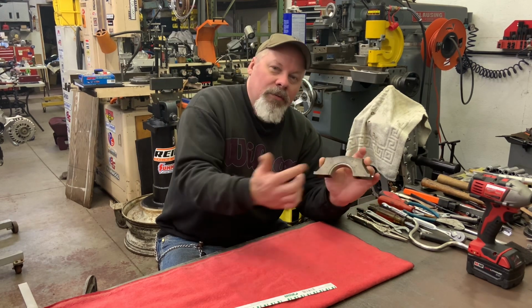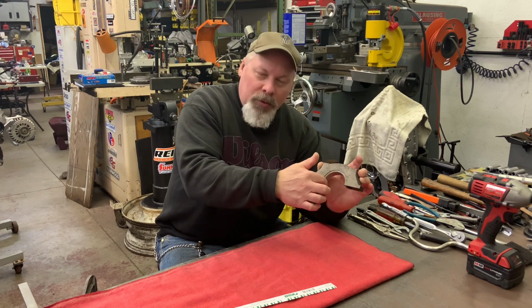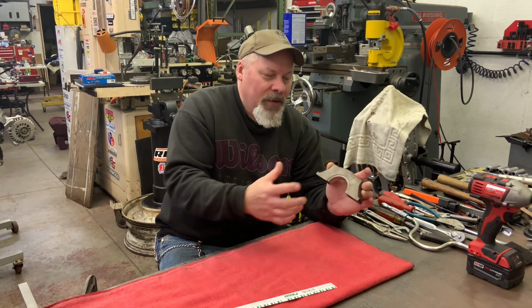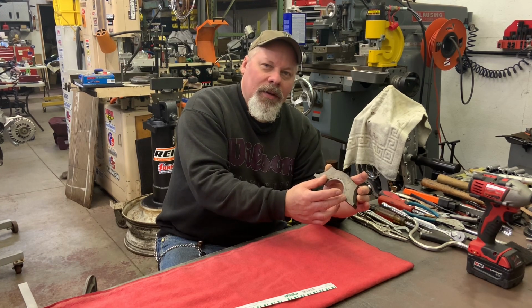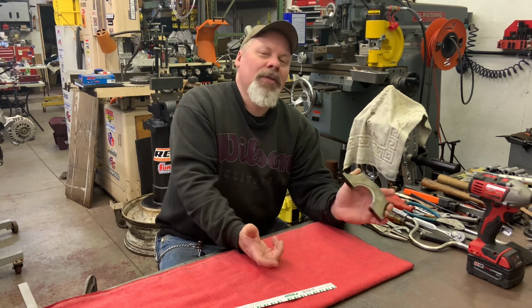This is designed for 2 reasons under normal operation. It's a little looser on the side, so oil can puddle, if you will. And under stress, in theory, when everything stretches, this will actually get round. If it started round, it would get too tight on the sides. It would pull it up. So that's the theory behind that.